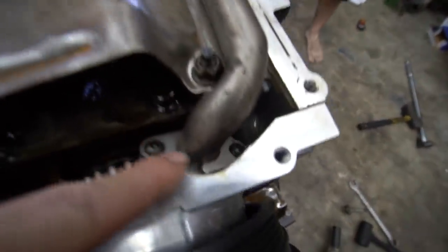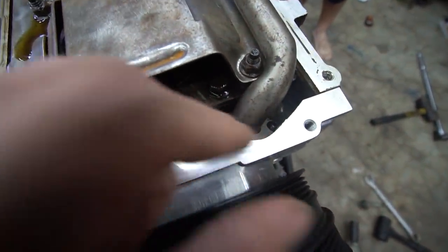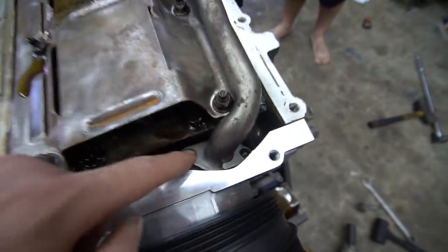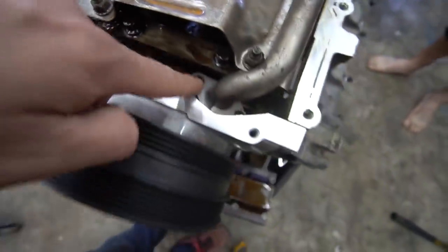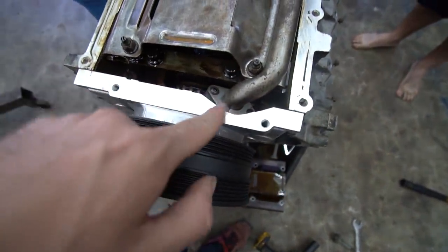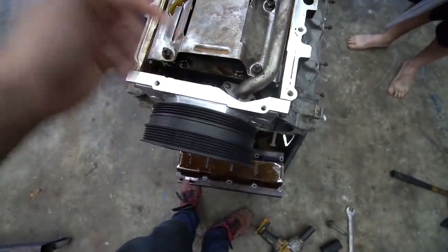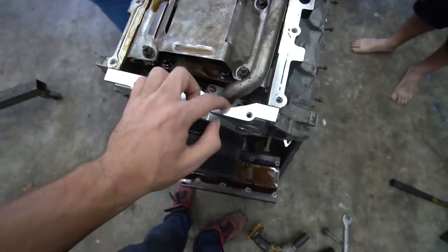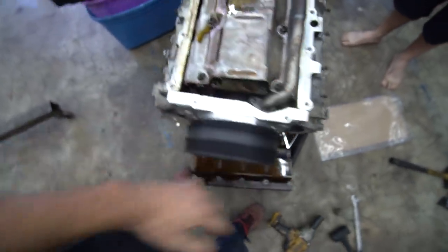Pickup tube is in. He did the same kind of brace I have. There are two bolt holes here — I'm assuming GM at one point had a two-bolt flange, but all the ones only have a single bolt on this side. What can happen is this can flex, tear the O-ring, and then you lose suction. Basically your oil pump is sucking through a straw with a hole in it and you lose oil pressure and blow your motor up. It's a simple, cheap little mod to make sure that never happens.